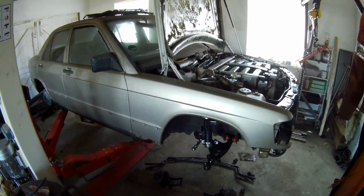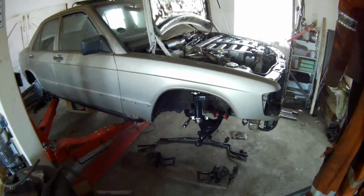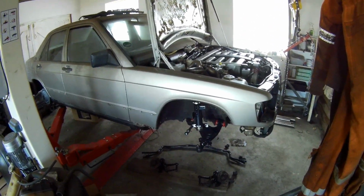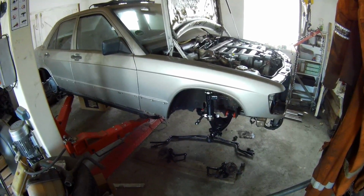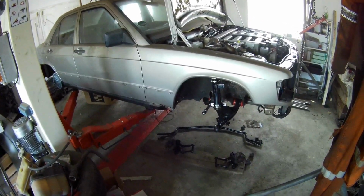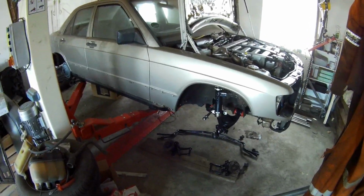And I think a complete set will cost you about 338 euros. And that's for Shore 80, that's red. They also have Shore 90, that is yellow color, but that's even stiffer. They say their Shore 80 is the normal road version. I think Shore 80 is already pretty hard, because Shore 80 is a little bit harder than new rubber bushings. And I think this is the best option.